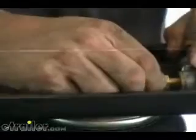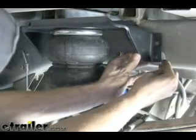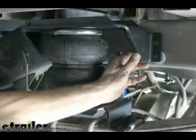Again, you don't want to put too much air in here — just enough to make it expand. That pushed up pretty good now. We're going to hold this up a little bit more and make sure we stay away from the curve of the steel right here so we can have plenty of room for a washer. This washer will actually go on the inside where our flange nut goes. It's a good idea to take this washer and put it behind our bracket right now and use that as a gauge to tell us how far up we need to go, so the washer will sit flat against the steel and not hit against the curve. Use a little marker to mark it, do our top hole too, and make sure we keep everything level. We'll go ahead and do the other side too. Got our holes marked.